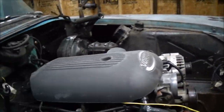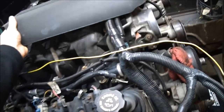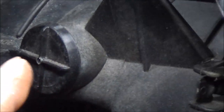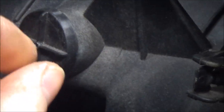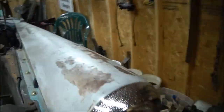Here's what I'm going to do with the transmission modulator. See that little cap right there — what I've got to do is sand off the little cross thing on it, drill a hole in the center, and JB weld a brass fitting in there with a nipple for the quarter-inch vacuum line. That's a good spot right there for vacuum. On the other side there's already one for the booster.